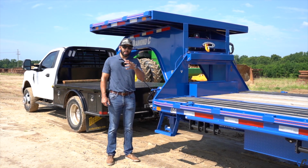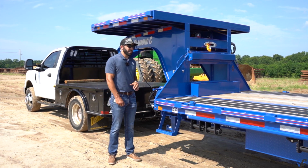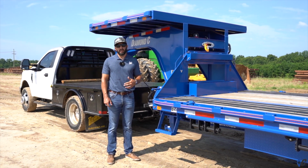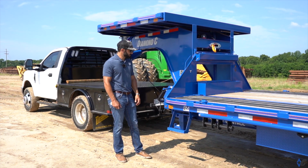We pull it out of the last stage, it goes through inspection, goes right onto a scale with all of its options, then the VIN tag is printed and put on the trailer, so you know exactly what kind of weight you're working with, GVWR, and then you can get your actual carry capacity out of it.